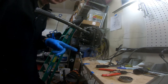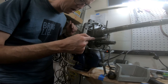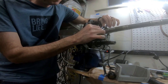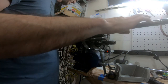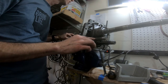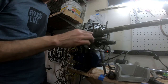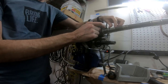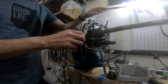Sometimes crappy snap ring pliers don't work, and so it took me a long time to get this one out. These snap rings are much thicker than my pliers were good enough for. Now that that's out, I have enough space where I can get on the back of this with a puller and try to slowly pull this out. I got that off and kept the reverse idler thrust washer, the idler gear bearing, the reverse idler gear, and the back thrust washer — all labeled and in their own bags.